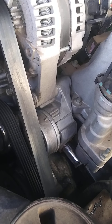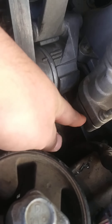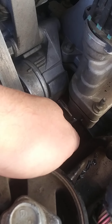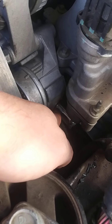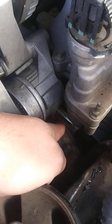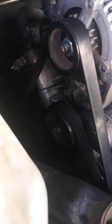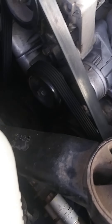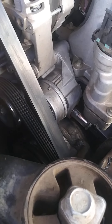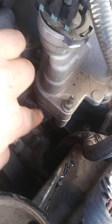After you take off the belt, the next thing is the alternator. The alternator has a bolt right here that's a 15 millimeter — take that off. Take off this harness right here and this 10 millimeter right here. Remember you disconnected the battery or else you're going to shock yourself. There's a 15 millimeter bolt here, a 10 millimeter bolt back here on this bar — keep everything organized. There's another 15 millimeter bolt under there and another one that takes off the whole alternator. You don't really have to take off that 10 millimeter; just unplug the harness and move it over.